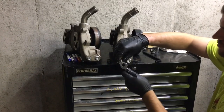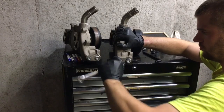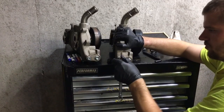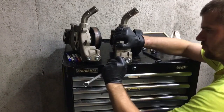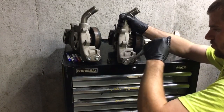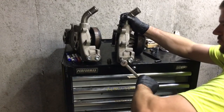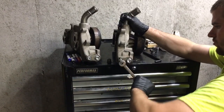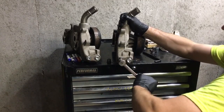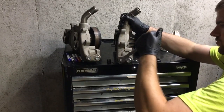So basically, that engine in the stupid Blazer, I ended up having to put intake gaskets on it, a new water pump, one new ignition coil. What else did it need? Seemed like a knock sensor. It needed at least one knock sensor. But other than that, it's been a heck of a motor for $400.